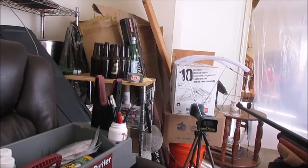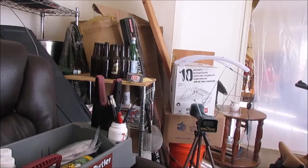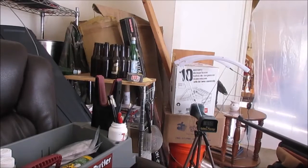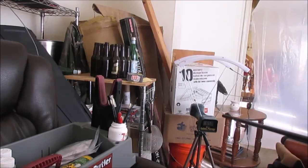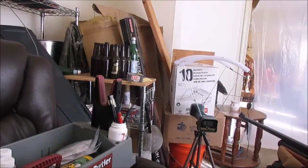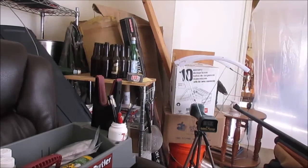I was wondering about that cross slot. That won't go in. Oh, I did it. About that cross slot cut in the front of the Archer air valve, sort of acting like the dish in a piston dome. Only in this case, having the opposite effect and giving more compression by way of giving more gas to compress. 641. Wasn't expecting that much variance, but whatever.